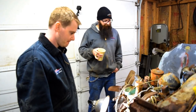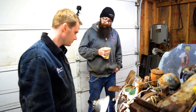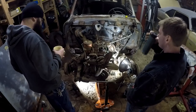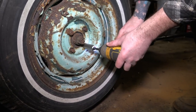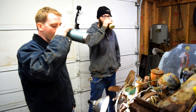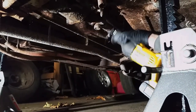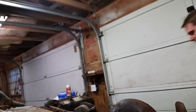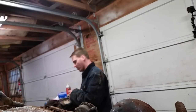I was trying to pull the tires off and I was like, man, these lug nuts are all rusted on there. Nope — they're reverse thread, left-hand threads. I was sitting there with the impact just making them tighter, socking them down super hard. It's an easy way to take off a driveline. I just really love the fact that we're replacing really oddball Studebaker stuff with really oddball Mopar stuff.